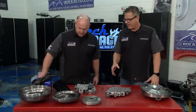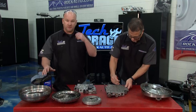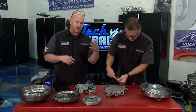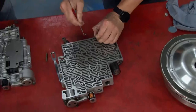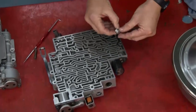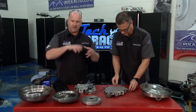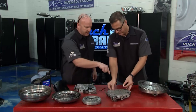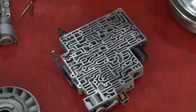We can actually pull the valve apart, which is really cool. You've got to think about transmission fluid — everybody knows it's important. Change it at the manufacturer's intervals and use the right stuff. You're looking at the engineering application of it all right here. You want the right fluid, you want it clean. Got to keep the filter clean to keep contaminants out. There's a lot going on in there and it's got to flow properly through this complex valve body system. If it's sludgy and old like tar, it's never going to work properly.